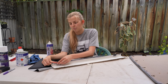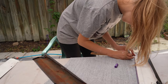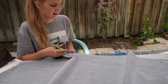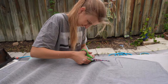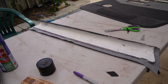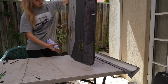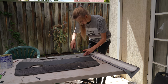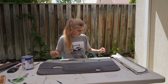This vinyl is just from Spotlight — I think the worst part of this whole making of the door cards was going to Spotlight. I'm leaving just a bit more than two centimetres extra so the vinyl wraps past the edge of the metal and onto the actual door card. This line needs to be perfectly straight and nice because it will be very visible — that's why I'm taking my time with it. The top piece of vinyl overlaps the fabric a little bit, meaning this edge creates the visual line between the two. Once it's all stuck down, we'll stick it to the big one. I think we're going to need the paint-on adhesive — a smaller paintbrush would be nice, but you've got to work with what you've got. Alright, that should be dry enough now — we'll stick them together.